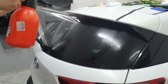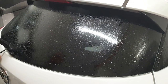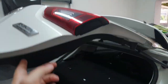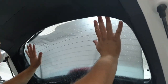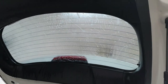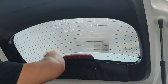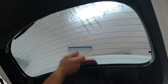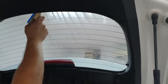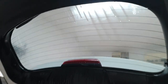The rear window is the trickiest one — removing the protective layer, as you can see, again applying a lot of liquid. Now let's see how it goes from the inside. The important thing is that the foil is cooled down. You'll see how it fits very well because the shape is proper and there's a lot of liquid so he can move it around. Even though it's a curved glass, there's no problem because it already took the proper shape — that's the trick for the rear one. Perfect.